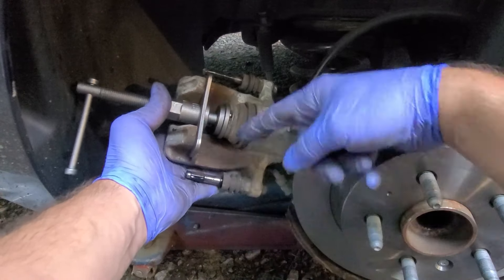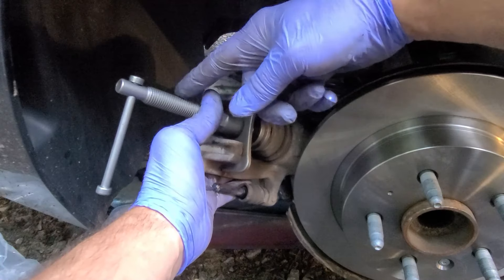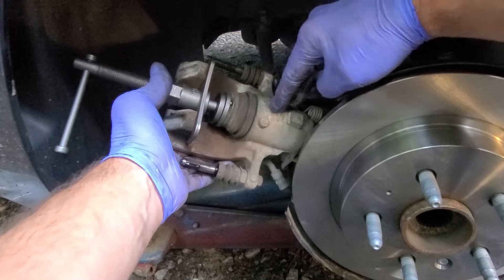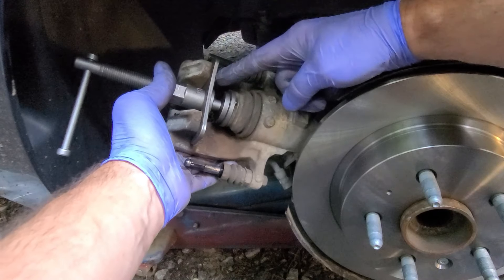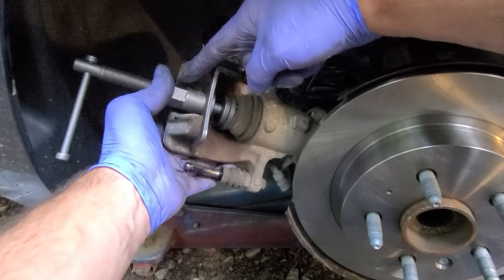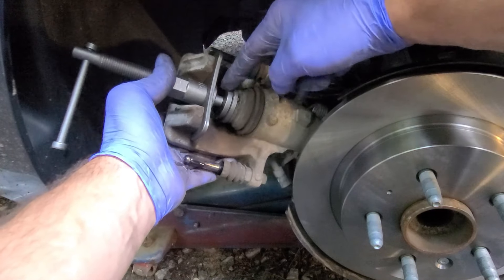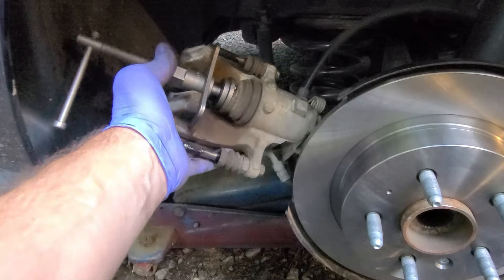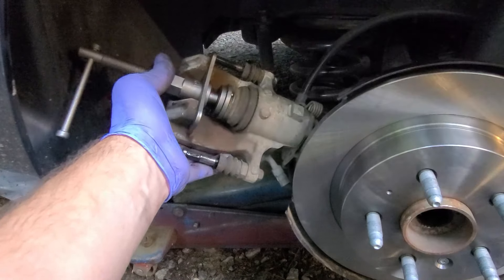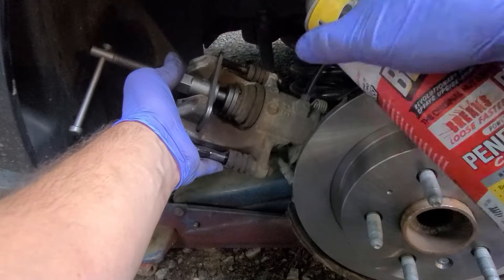So that's what it's going to look like. When you turn this, it's going to rotate that piston to push it back in, and it's also going to push against this to force it back in. As this goes down, this right here will get loose, so you'll have to continually rotate this to keep it having pressure on it. This boot here is going to want to rotate with the piston. What we normally do is put a little bit of penetrating oil on it — it keeps it spinning.